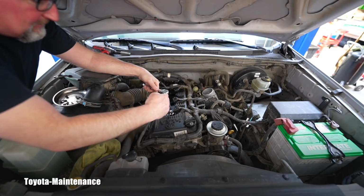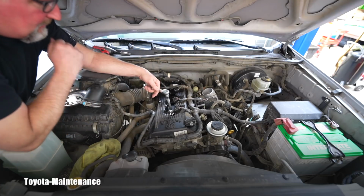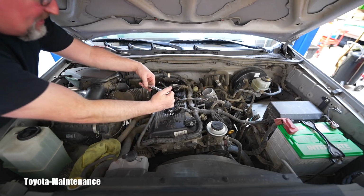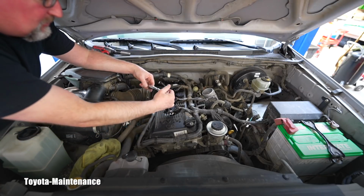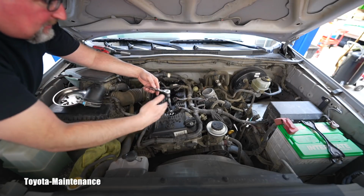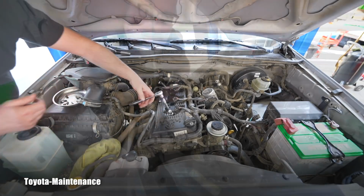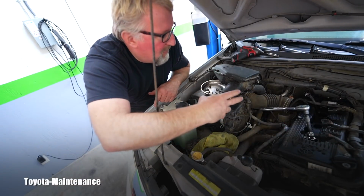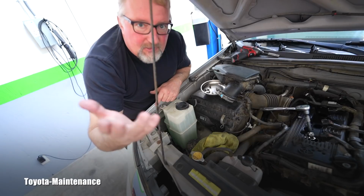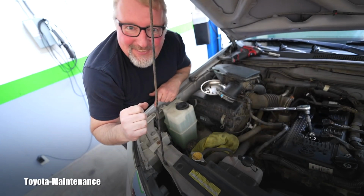So I did right now, this is a 90, and half of the 90 is 45, so I did like 130. I stop here. This is the resistance which I normally use for those spark plugs. So not even 180, approximately an angle of 130. I will continue with replacing the remaining 3, because that's just an absolutely identical procedure, and then we will continue with this video.